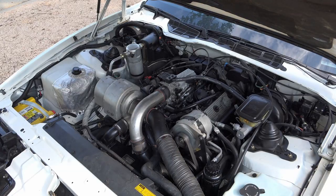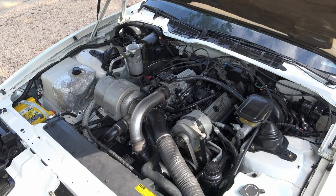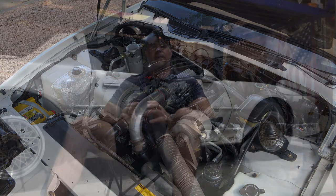Now, 5,000 miles on a car of this age that's been sitting this long — it's not good. I tell my customers with classic cars: drive your cars, they're made to be driven. When I bought this car, of course it had no leaks — but of course it doesn't, you haven't driven it to find the leaks. I knew what to expect. One of the first things I attacked were all the bushings. They were all shot and decayed. The rear sway bar didn't even have any bushings, and end links were missing. We replaced all of that.